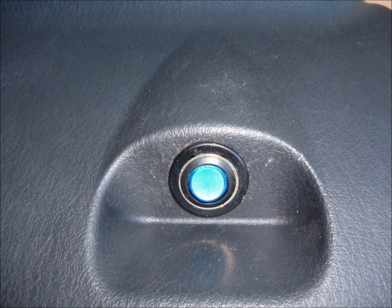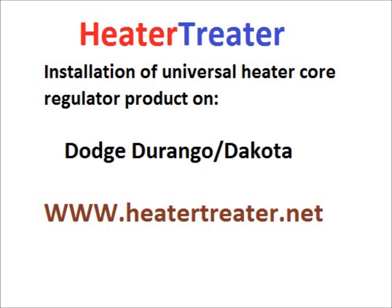So it's coded. It's a blue light. When blue is on, that's AC. That means no water is flowing through the heater core, and when the light is off, then you do have heat. This is a fairly simple repair for a Dodge Durango. We think you'll find it easy to use and very, very effective. And actually just pulling the heat out of the heater core gives you better AC.